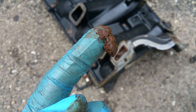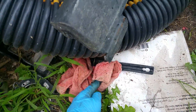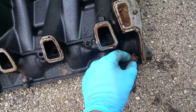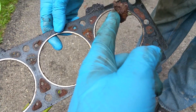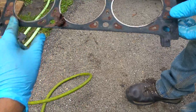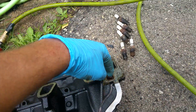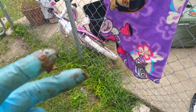Let's not put radiator stop leak in our radiator. This copper radiator stop leak crap tried to plug the holes in the head gasket on the old one. It wanted to plug the head gasket all the way - that's what it was trying to do. I'm scooping this stuff out. It was trying to plug everything. Fix the problem, don't just take pills.